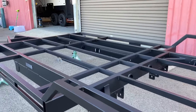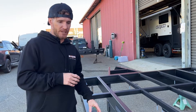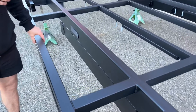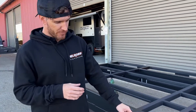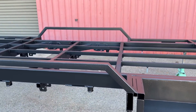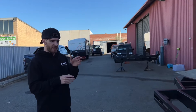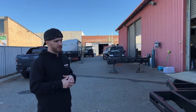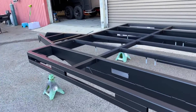One of the final elements I'll talk about is where we fit our EPS panel — our wall panel. We actually slide them over this chassis rail here. It's a 50 by 50 by 1.6 mil rail and that's why we run it straight over the wheel box as well, so we've got an attachment right the way through including the wheel box area. That's quite different to a lot of manufacturers where they either have a Z-section or just a drop-in where it sits on the side of the chassis. We're actually sleeving our walls straight over our chassis before we lay the floor, which is quite a different building technique.